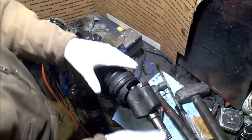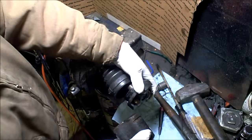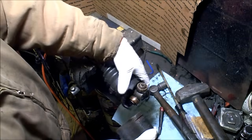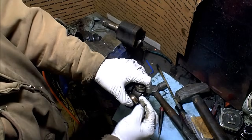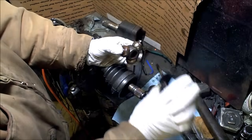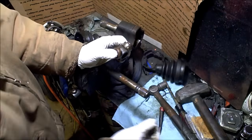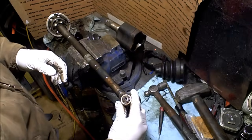We'll start this side — it's easier. On this particular one, there's just a retaining ring right here that just retains it, so this snaps off. This comes off and you just got a housing here. And then there's a little C-clip that was down here. We'll take this off, take off this little retainer, and take off this little rubber protective boot. And all you have here is a set of splines, essentially, and this just splines onto here.